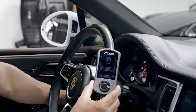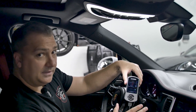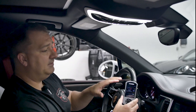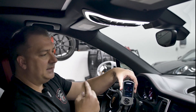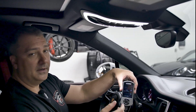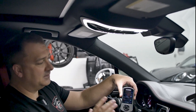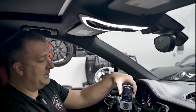It says to turn the ignition to the off position for 15 seconds, but I'd recommend leaving it in the off position for about 60 seconds — just do a full minute. The reason being is there's a reset of some of the adaptations, and your sport and sport plus modes, if equipped on your car, need about 30 to 45 seconds to reset. If you turn the ignition back on before that, you will not have use of your sport or sport plus modes until your drive time is about 15 minutes. The best way to avoid that is just to leave it off for a full minute. After that, you can cycle the ignition back on, start the car up, take it for a spin, and enjoy the power.